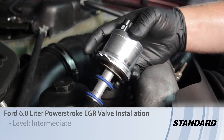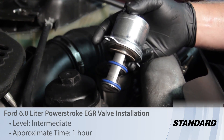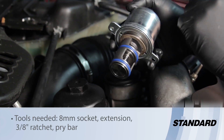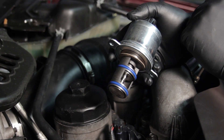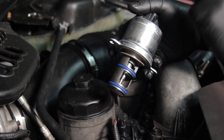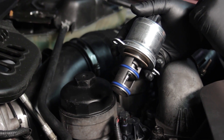Let's discuss replacing the EGR valve on a Ford 6.0L Power Stroke diesel. There are a couple different ways in which this could fail. We've got the valve here with a couple of moving parts, and it could get stuck open with carbon — that could cause some drivability concerns as well as a no-start condition. Our particular valve today is stuck shut and setting a couple different trouble codes, so we're going to go ahead and replace this valve.